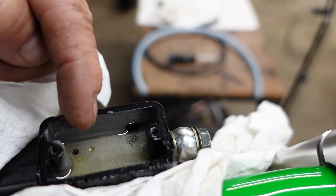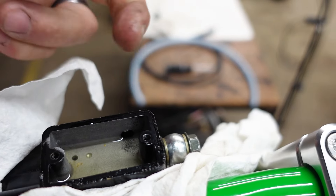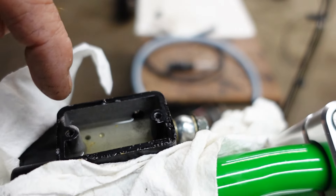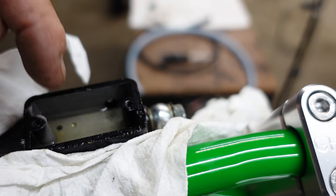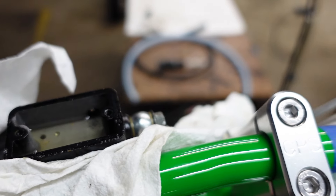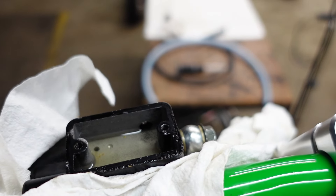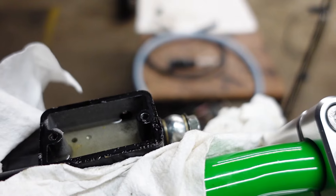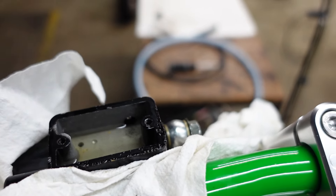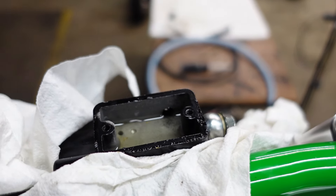Put some paper towels around there and don't squeeze your lever too hard. You can see the little holes in the bottom of your reservoir — that's basically where your mechanism goes in. The sight glass is over in the corner so you can check the fluid level from the back side. As you're lightly pumping, that's where it's going to be spitting fluid up, that's your pressure pocket, and the little spring pocket is your return.